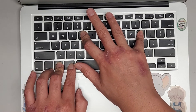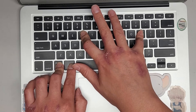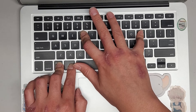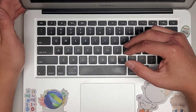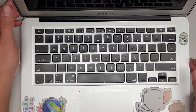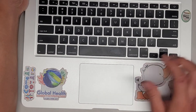Now we're going to do a PRAM reset — power it up, hold command, option, P, and R. You'll see the screen go off and then it should come back on by itself. Usually you'll hear the startup chime — that's how you know you did it right. If you keep holding it, it'll chime a second time. Their Mac was muted, so that's why it didn't chime the first time. It turns itself back on — now we'll let this boot back up. The trackpad is still good even with the battery screwed into place, so that's a good sign.